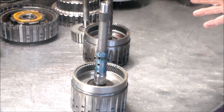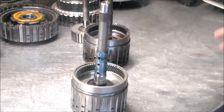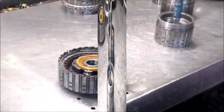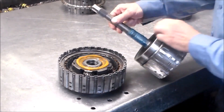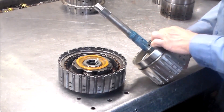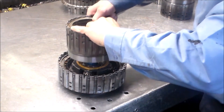Let me back up a little bit and we'll just put the front assembly together with the A-drum, the E-drum, the hubs, and put the snap ring in. So we have the A-drum here — here is our brand new E-drum. I got these rings pretty much secured in here with the transgel. These rings are very thin, so I want to make sure they are in their spot.